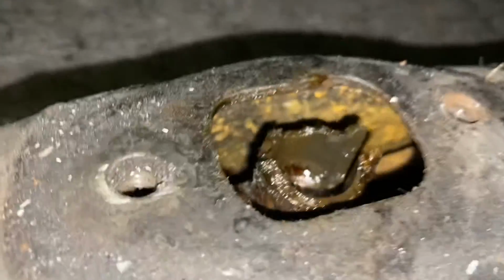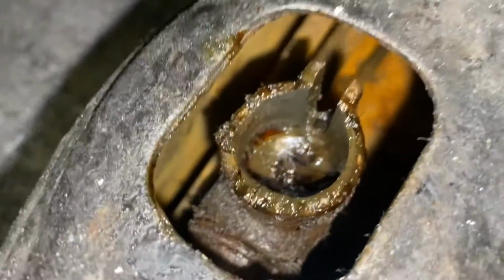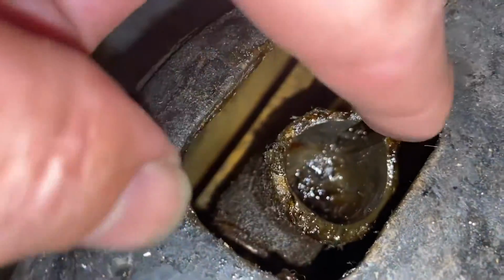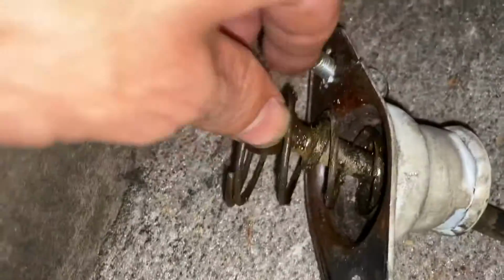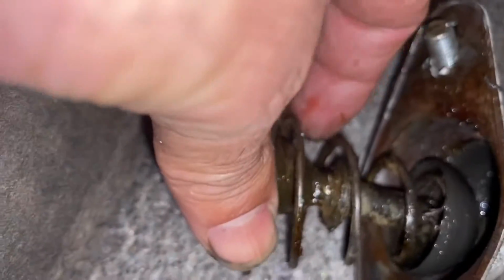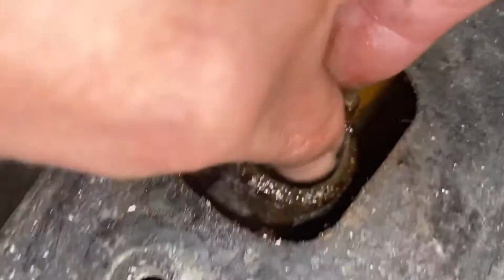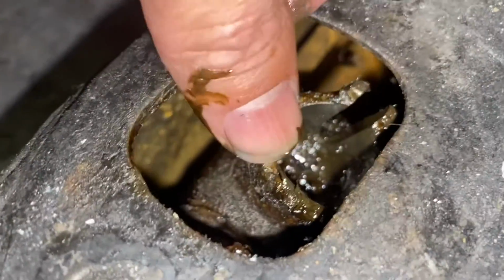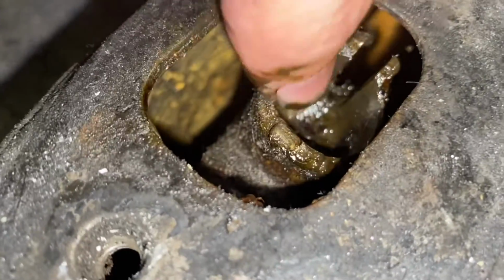And there we go. There's the, I guess, socket, ball joint, sort of, for your shift rod. And then this looks like the earlier ones have this groove in it, so that dowel there can fit into it. I don't think it's on the later ones, but I don't know. Either way, now we have the ability to turn this over and rotate it. And you'll see how that's going to make working on the coupler a little bit easier.